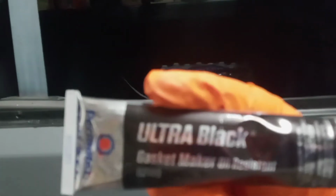So once your paint has cured, you want to wipe down your window frame, like here. You guys can see where I've drilled the holes. And yes, some of them are close, but I think with the nuts that secured them, we'll be okay. You're going to take some RTV. I've got some Black Ultra RTV. I said earlier in this video that I got the wrong hardware kit. Well, it was also missing the RTV, but Affordable Offroad offered to send some, and I already had some in the garage, so it didn't make any sense if I wasn't going to use it.